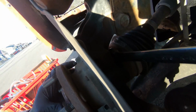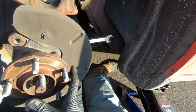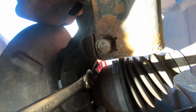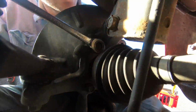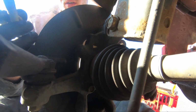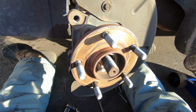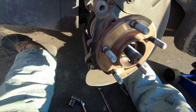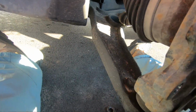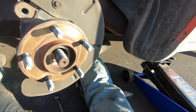Okay, again, to make yourself enough room, you can just push back on this axle here. There it goes, loosen up. That'll give yourself enough room to work this wrench back here. Perfect, rinse and repeat for all 4. Okay, now usually these are rusted on a little bit, so just give it a tap with your hammer. Just work your way around it like that. Just keep tapping it and it will come loose. So yeah, we'll check back in, just tap around the sides like this.